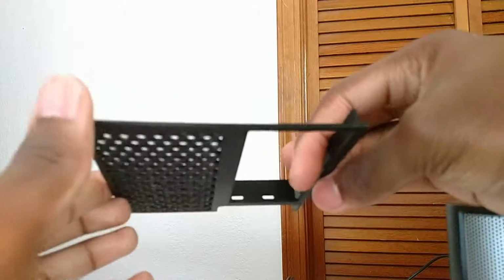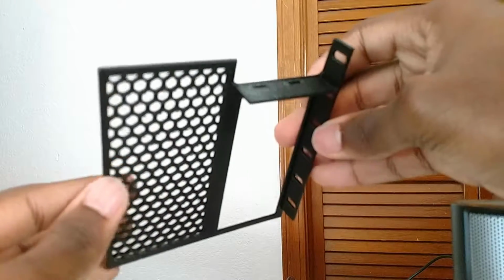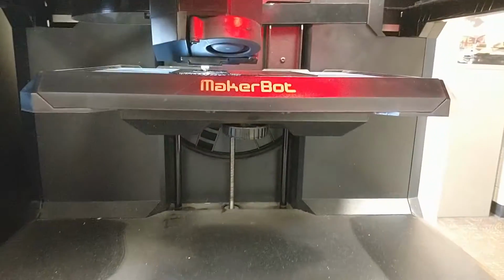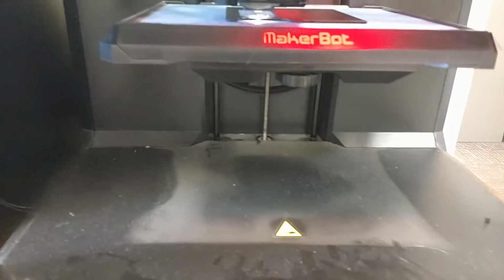This will only work with ATX cases, but with that aside, this is fairly universal. You do have to remove the bars going across the expansion bays, which I'll touch on in a bit, but overall it's really straightforward. I printed this using a MakerBot Replicator in my engineering class, and I'd recommend printing this on the flat side so you don't need to have any support.